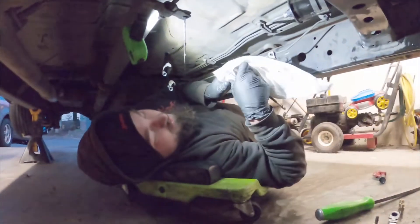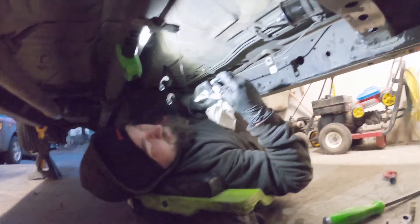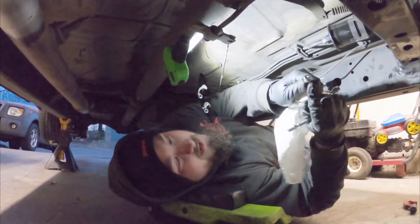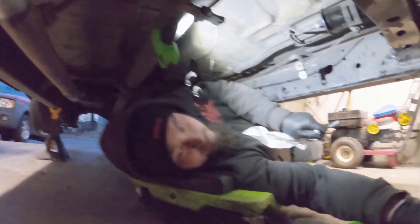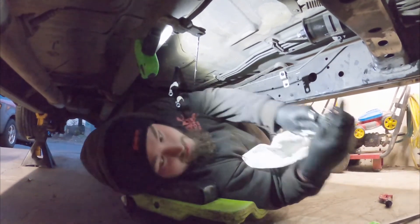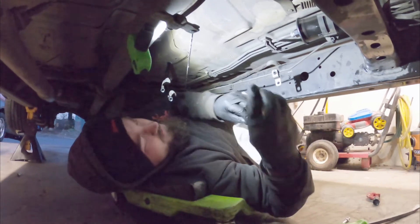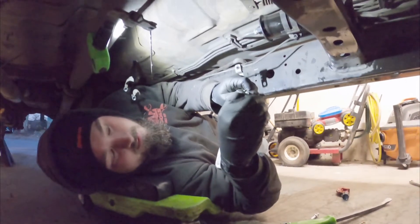They give us these cool little short lines - one and two, one's got an elbow on it. Mainly what we're trying to do is adapt this fitting to essentially this fitting on these two lines. We're going to have to use these elbows to connect this line to this line. Then we'll take our main brake line here and put fittings - two fittings. Those are the factory Toyota fittings on this line. Once we cut it in, those fittings adapt to this right there.